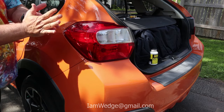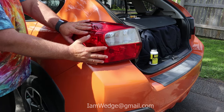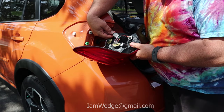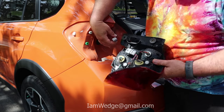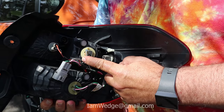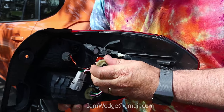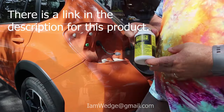Now when I take these off I usually lick my hand, put your hands on your lens and just give a little push back. I'm going to be taking this connector off just because it's easier to work with the light — press on the lock right here and just pull it out. Here's the one for the blinker that we're going to be taking out. See the two little tabs on here? Thumb and forefinger, turn it counter-clockwise, pull it out. This is the 7440A bulb that you'll be replacing.